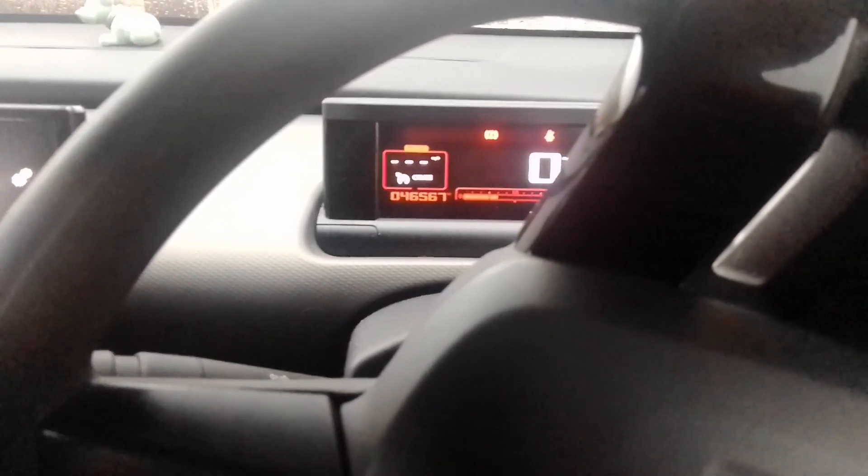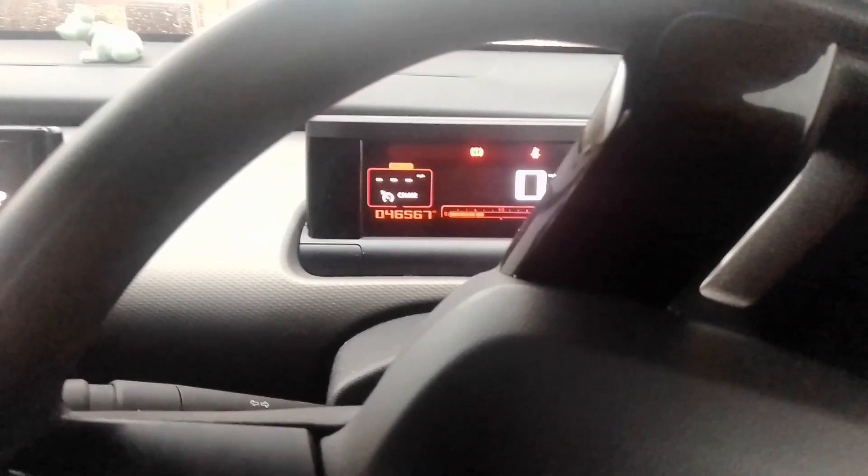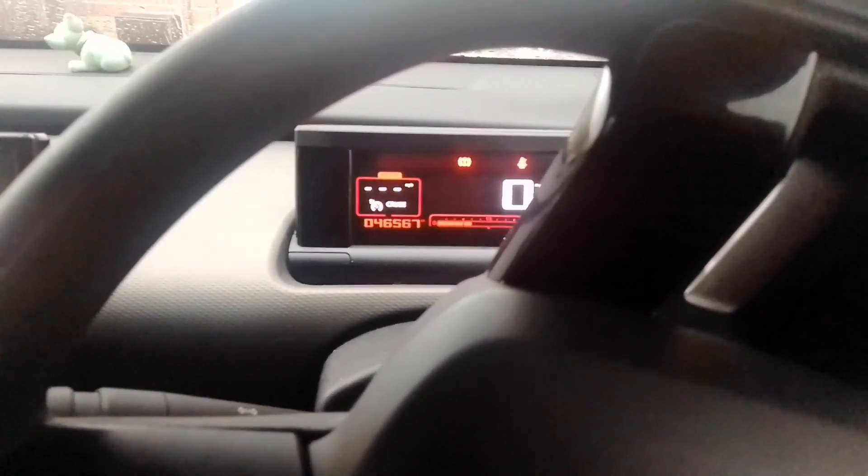I've basically disconnected the smart alternator and that will now charge the battery at 15 volts. It may also put on warning lights on the dashboard — you'll hear the car labour a wee bit — and then it's sorted. There aren't any battery warning lights or error messages displayed. The car is running and it's charging the battery.